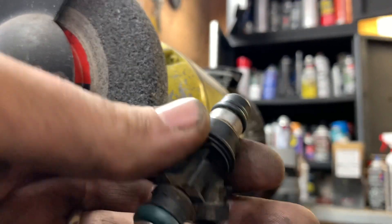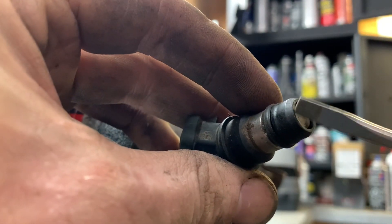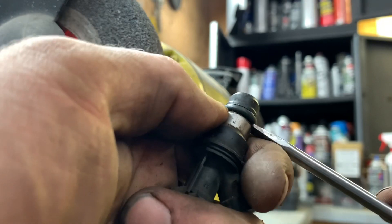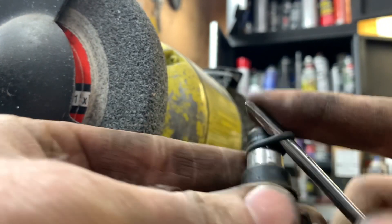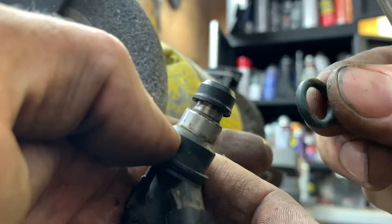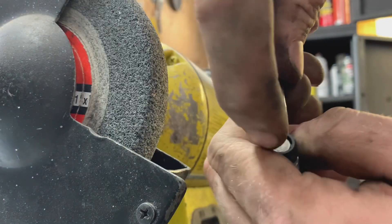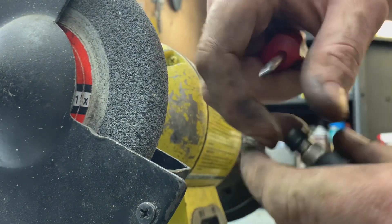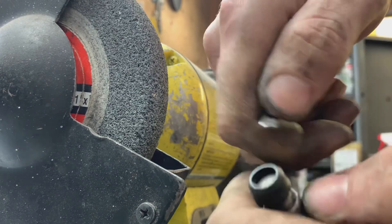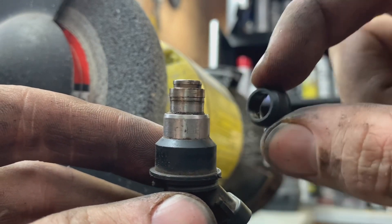All right, we're zooming along here pretty good. What we have to do now is remove this plastic cap and the rubber o-ring from the injector — that'll allow us to get at the cap we need to remove. So first we'll hook this injector o-ring seal off. Okay, that's off — now we've got room to get at the back of the cap. This can be a bit funny but I just like to hook my finger under here and then pry up on it. These can be tough and you might have to try them a couple of times.